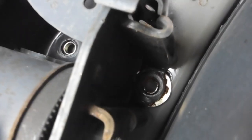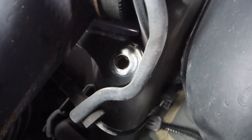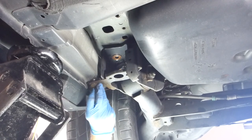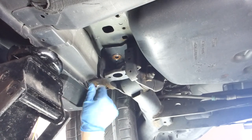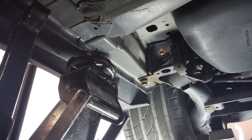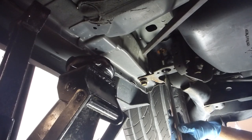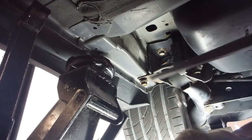Here's what it should look like after the three collars are installed. Unfortunately, I did not record video of the third collar placement, but the process is exactly the same as the two that you just witnessed. Note that with a gentle push on the sub-frame, I can line up the bolt holes as necessary. I start the process of bolting up the rear sub-frame by hand tightening the easiest accessible bolt, which is the one with no collars. You can see a lubed collar is stuck into place already — that's our special collar that is uniquely sized, so make sure that it is installed in the appropriate location. I'm using a second jack to lift the rear of the sub-frame so that I can get the bolt hole to mostly line up. Then, with a crowbar, I can get the hole to line up perfectly and thread the bolt into place by hand with minimal effort. Cars are bigger and stronger than you, so use appropriate tools to be smarter without frustration.